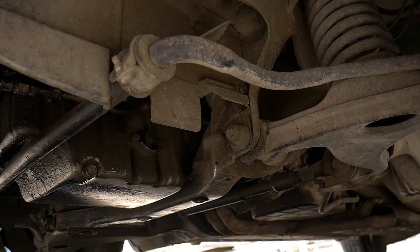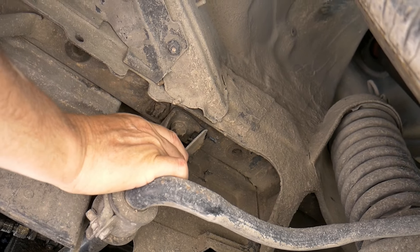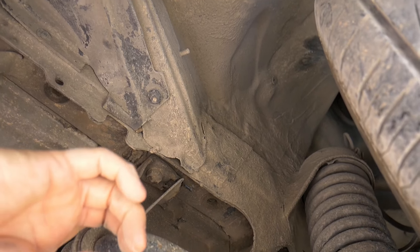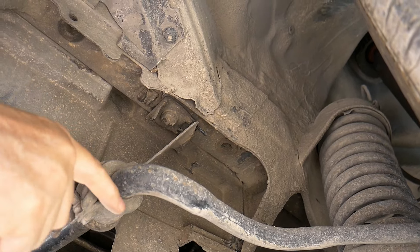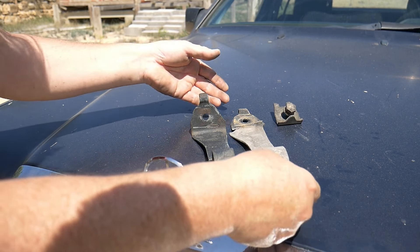I've raised the car and I hope you will be able to see it. So that's the part we want to remove, you can see. What I'll do is remove the two bolts of 13 here, then recover the part, and then remove it on top there. You will see as well that where the bolt is, there's like a squarish washer. At the same time that you're going to remove this, just have a look at those rubbers, because it's possible that you may have to change them as well. Let me remove this and take the part out — I now have the part.